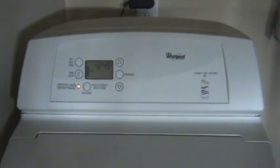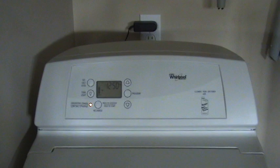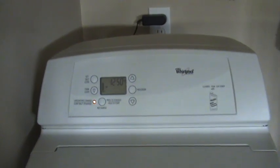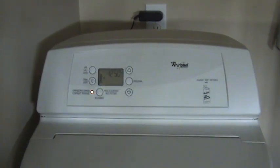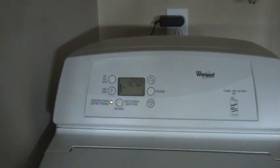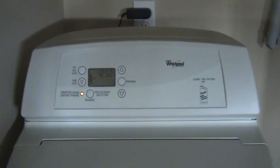This should take around two hours depending on your unit, so just let it do its thing. One last note: once this is finished, you're going to need to open a cold water faucet — not a hot water faucet — for a full 20 minutes to finish flushing the system and make sure that no trace of that cleaner is left in your water. Once you do that, your water is ready to go. You can now take all of your notes down and turn on your ice maker.